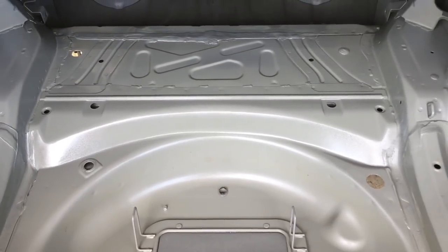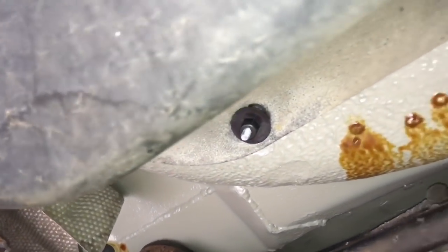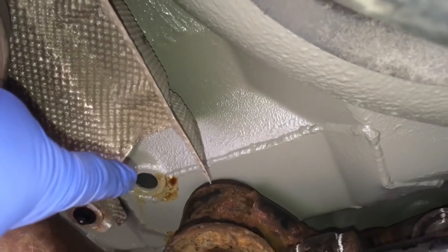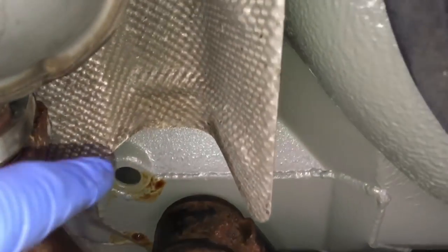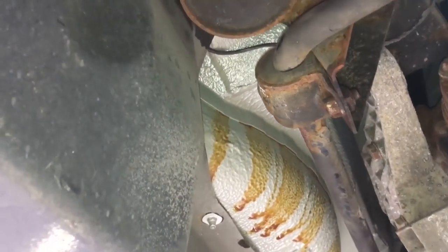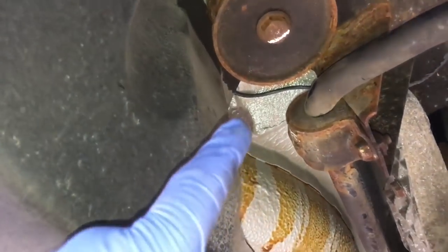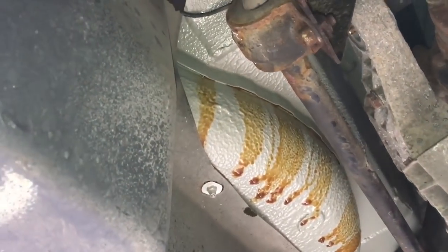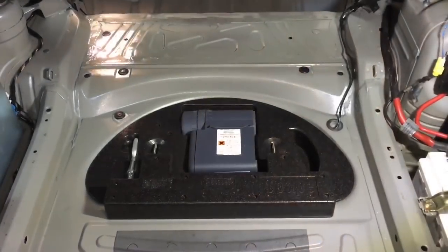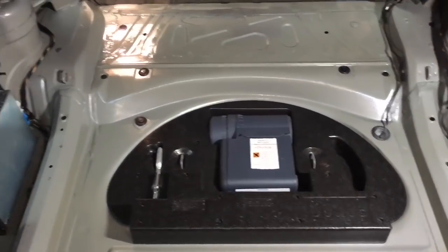I've finished the painting on the inside of the boot now. You can see the stitch welding quite clearly — painted the top of the rear axle carrier panel, a bit of blend into the chassis legs, and over the boot floor panel with a gentle blend down to match the original colouring. Now we can get on and do some cavity waxing. We're just topping up the cavity wax going into the front sections. You can see wax coming through and dripping out of the flutes of the join of the rear axle carrier panel to the boot floor panel — making sure all the inside areas where we've done welding are completely protected with a wax content, actually more than the factory ever put in there.